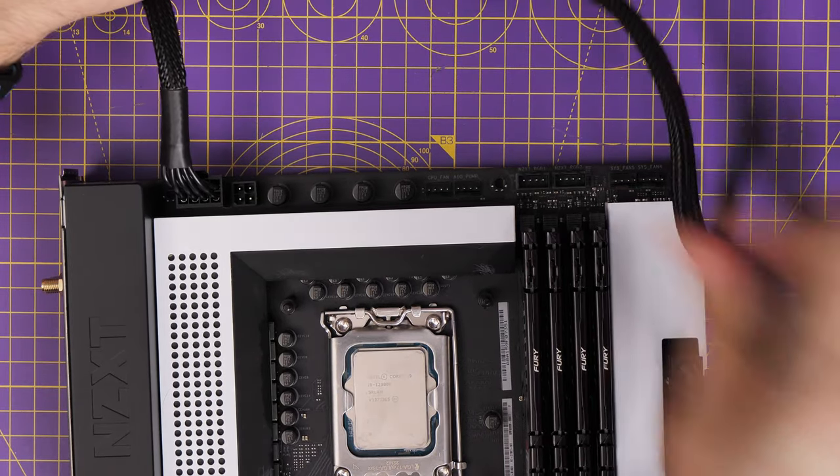Once you're sure of all the cables you're going to need, I'd recommend plugging them all into your power supply unit before installing the PSU in the case. It's much easier to plug these ends in when it's outside the build than when you've got it inside the case and have to fit your hand in there. This will definitely make your life easier. You would actually do all the things I've shown — seating the motherboard, then doing the power cables — but I showed you outside because it's easier to understand.